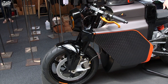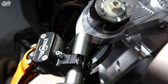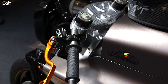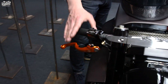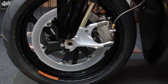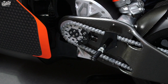The yokes are CNC machined, as on all our machines. What's particular on these ones is that we don't have clip-ons — the handlebars are actually five-axis CNC machined and threaded onto the yokes. Full Brembo brakes: front brake on the right as on any conventional bike, but the rear brake is on the left, which gives a little more feeling in the brakes and it cleans up the footrests.